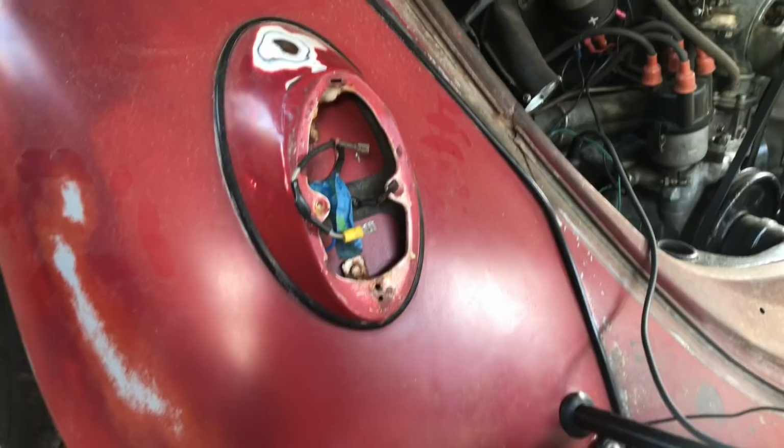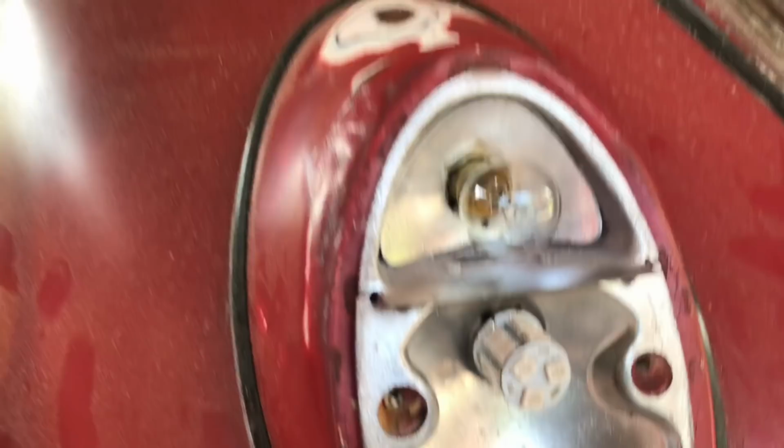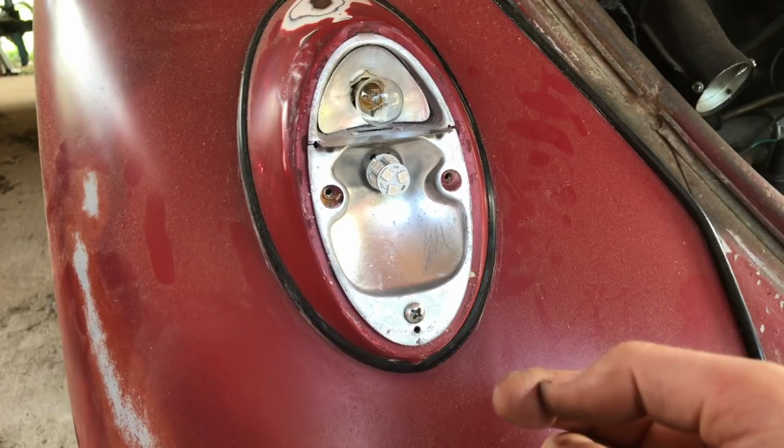I've had a test light on all of these connections, and they're good. From the key, you hit the brake, the brake light comes on, plug into the tail light comes on, and the turn signal works. But the housing, something is wrong with the housing. Problem solved. This car, we did run LED, red LEDs in the back of it. Those housings have a little thing inside that looks something like this. This one has the older style in it.